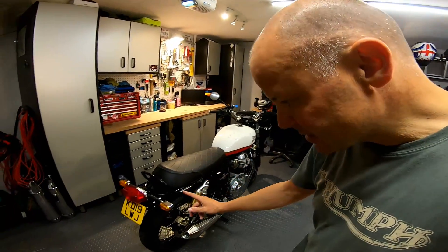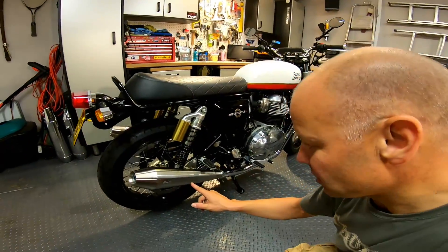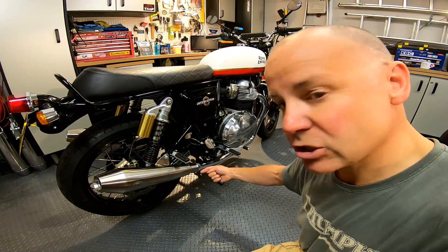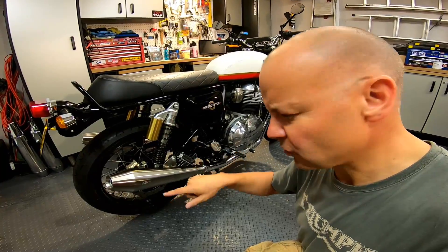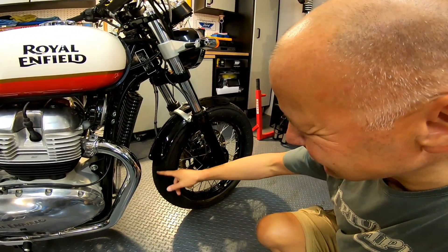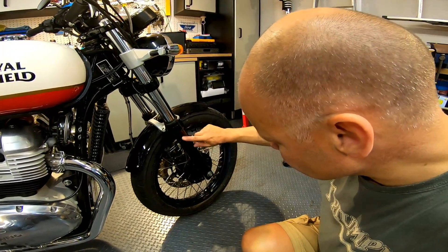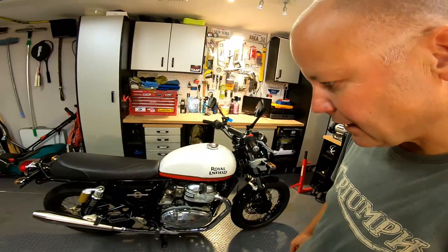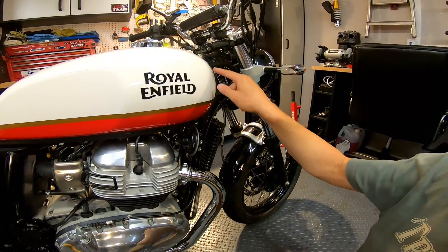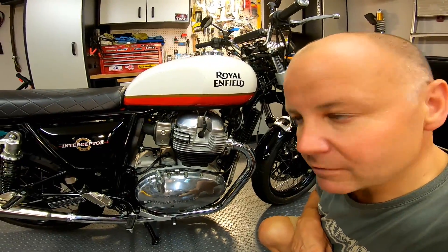To summarize: I've fitted a slightly smaller number plate and taken off the plastic monstrosity at the rear — though this rear end still needs some tidying up. I've got the Tech Bike Parts Canon silencers on — 'silencer' being the wrong name since they've made it louder — and saved at least four kilograms of weight. I need to put a little exhaust tape around the join to neaten it up. Tech Bike Parts link below, £300 for a set — money well spent. At the front I've tidied up the mudguard. I also put some black masking tape around the tank to blend the seam into the black frame — just makes it look a lot neater.